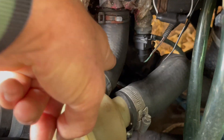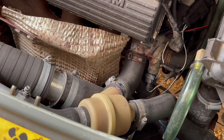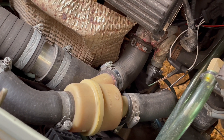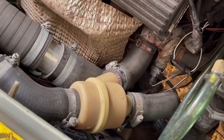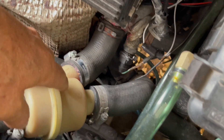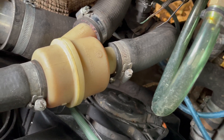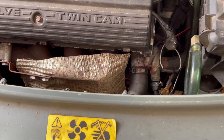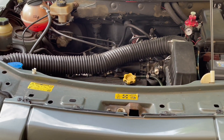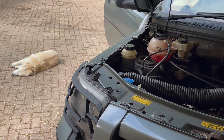This hot water from the engine goes off to the radiator, so it behaves exactly like a normal output-style thermostat — which, by the way, is the type of configuration they use when racing K-Series engines in MGs and the like. They normally resort to quite expensive metal-housed thermostats, made by QED or similar, but you don't need to spend any money — just reconfigure the pipes, move the T-junction from up here down there, cut a few pipes, and maybe add some spare bits of rubber hose. That completely fixed my idling overheating problem — I can sit idling all day long and the temperature stays perfectly stable.